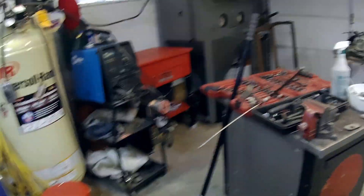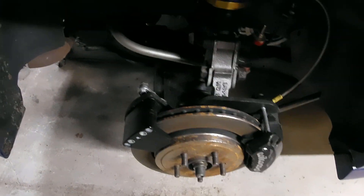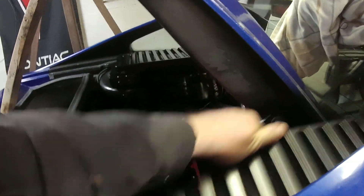I made some brackets to mount the parking brake cable right here for the spot caliper. I've already got all the cables run and routed through, and I've got a little tab on the cradle — they're all tack welded into place until I can see if everything's going to work. There are the deck lid vents, freshly picked up from the powder coater. They turned out absolutely amazing. Let me show you what I've got in the car — I need to hook up the battery.